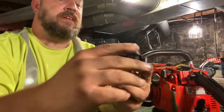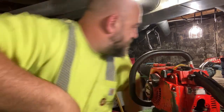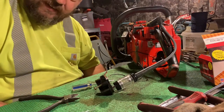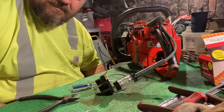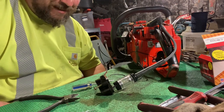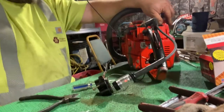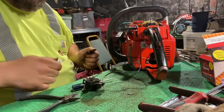I'm going to get some wire and see if I can figure out a way to get a jumper from here up to the engine. I've got this all rigged up — let's figure out if this thing's got spark, because if it's got spark we definitely have a fuel issue. This took me 20 minutes to rig up. There's a red spark — it's actually good and strong. So I'm 100% convinced it's a fuel issue.